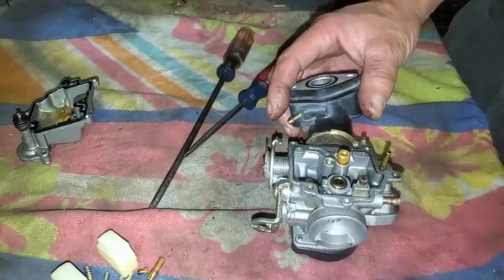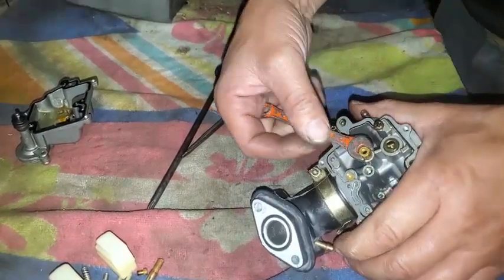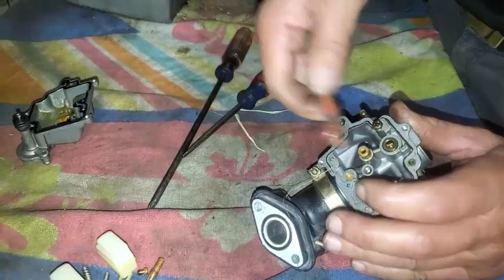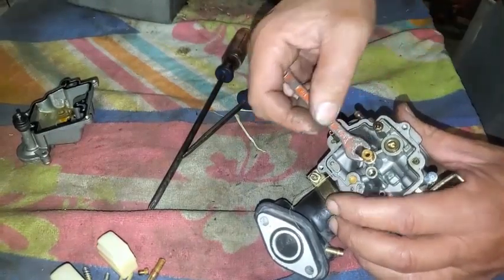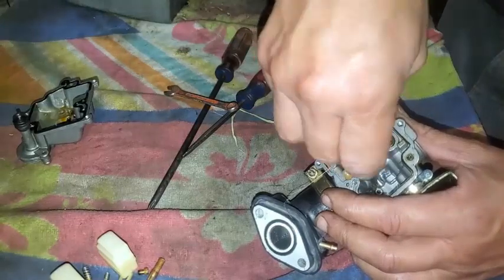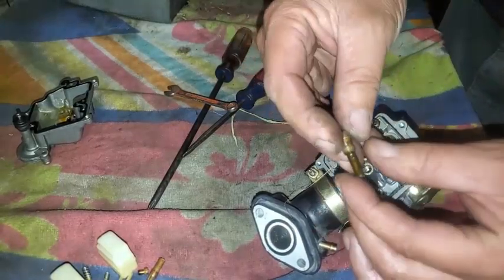Let's get this one off and grab the wrench. I had to go hunt down a wrench — this is not the right one because this should be metric. This is a quarter inch; the box end won't go around it but the open end will. So let's see if we can get this main jet out of here. The jet is open — I can see light through there — but those tubes along the side have goo. I can see the goo coming off my finger.